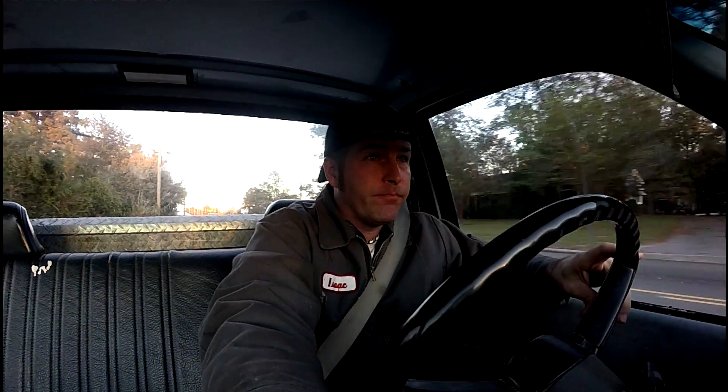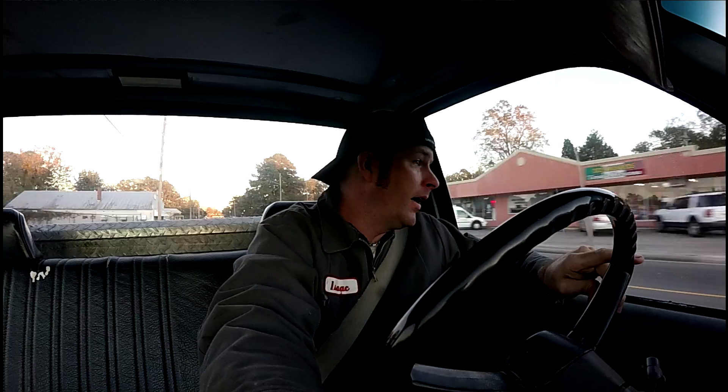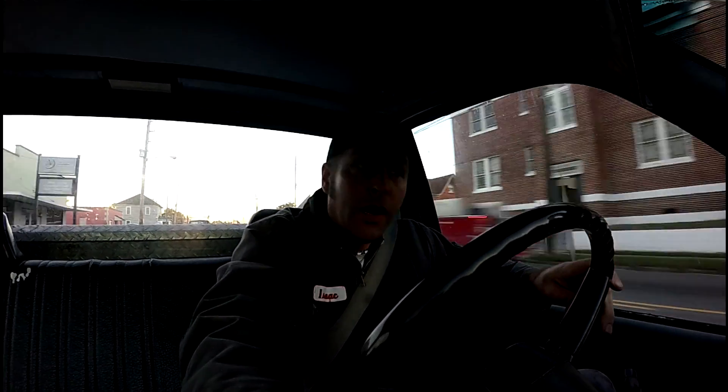Heading to the warehouse, I just realized I don't have any running lights on my truck. I need to drop by the local parts store and pick up some fuses. I tried airing up an air tank with my portable pump and I blew the fuse on the cigarette lighter. Well, the parking lights for some reason are hooked up with the cigarette lighter, so I've got to replace the fuse, then I'll go to the warehouse.